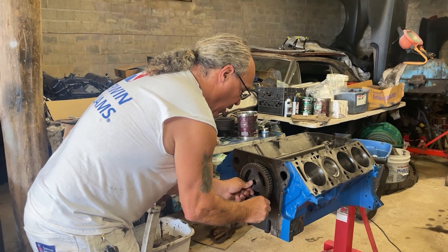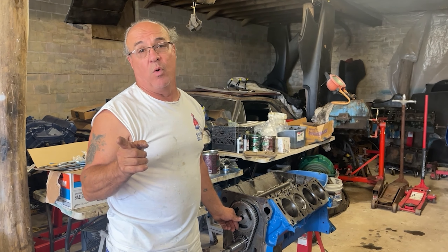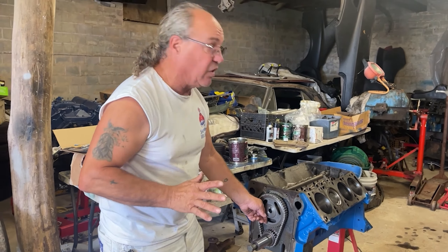That's much better. Boy, that other chain made me nervous, man — I just didn't like it. You know how hard this was to get? I had to go back through Merkel and he had to go through all his list of numbers to get this. What a pain in the neck. I won't do a 391 anymore — not stock back to the way it was. Everything is different. The size of everything is really different. The pistons are the same, the cam is the same, but the crank is different. It's a different snout. I'm happy we finally got most all the parts. The oil pump was another one — everybody had the wrong size because it's industrial, heavy duty. You've got to have the right pump. It's not a 390 pump — it's a 391. It's not a FE, it's a FT.